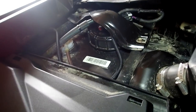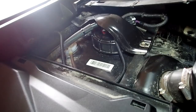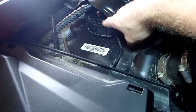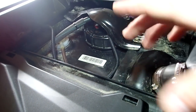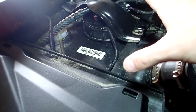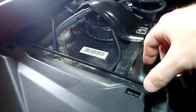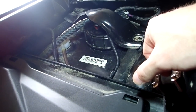With that, we have put in the new fuel pump. I'm not going to button it all up because this bezel is just awkward — it's under a lot of spring tension from the fuel pump on the inside, and it's difficult to really know if it's going on evenly or if you're cross-threading it. So I'm going to leave it unbuttoned until we start it, when the project is done, to make sure I'm getting good fuel pressure and there are no leaks. Moving on to the intercooler.